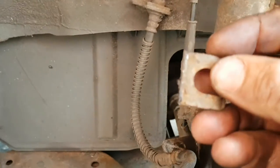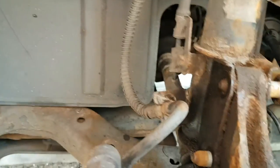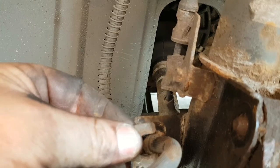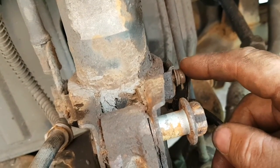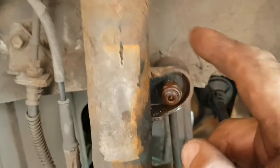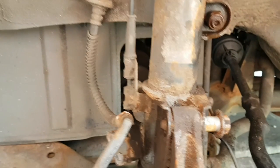and it has the horseshoe clip on, what holds it in. Just get a screwdriver and just tap it out, that'll pop out there. That pops out, in like that. Just pop it out, pull your brake pipe through like that, free that off. Then you got your ABS sensor here, that's a 10mm bolt here, just undo that, that pops off there out of the way. So then soon these are out and that's off, the bottom's ready to come out, so I'll get these off, then I'll be back.